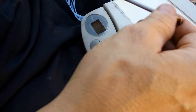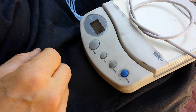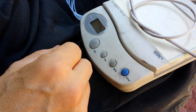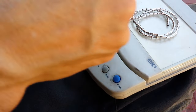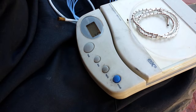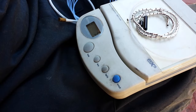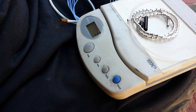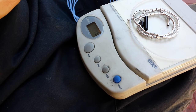To compare the weight, let's first take this piece of traditional housing with the ferrules. It weighs in at a little more than 17 grams for this small section. Now with the alligator housing, the internal plastic housing, and a couple of end caps, we're at 5 grams, just a little bit more. That's a pretty huge difference, and this piece is just for the rear derailleur.